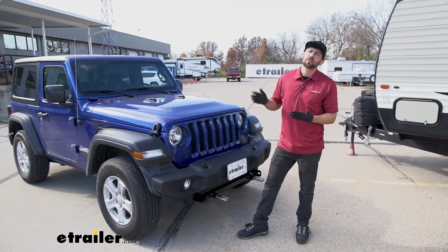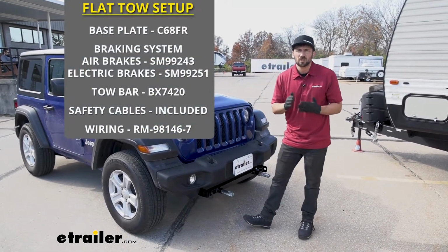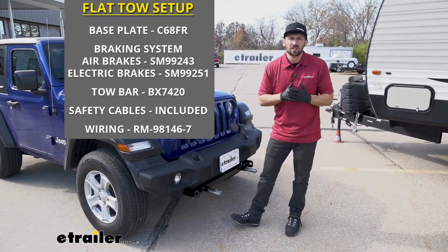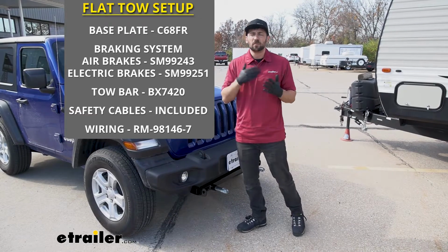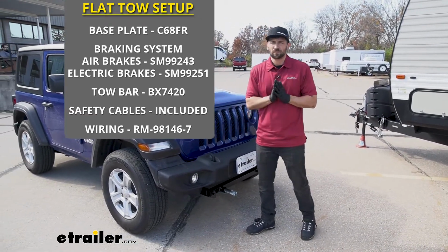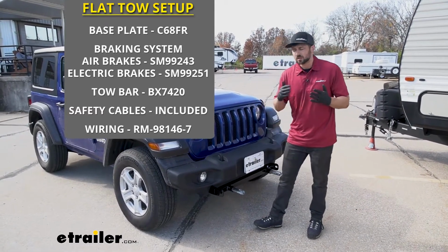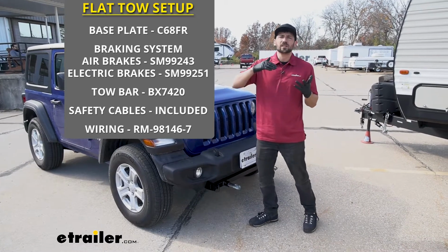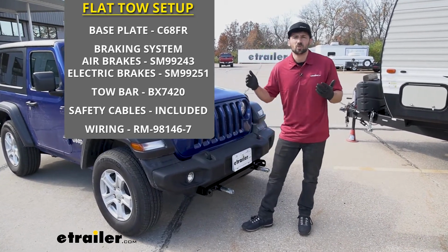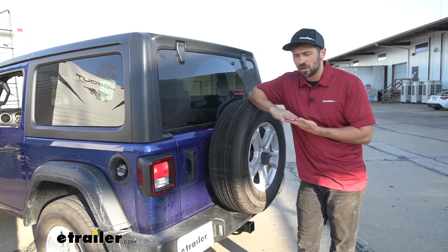There are actually a few other things you may need to flat tow the vehicle. A few of these things are, number one, a supplemental braking system. This is required in most states. It's not an actual requirement to flat tow, but many states do have a stipulation based on the weight of the towed vehicle. Some other things you'll need is a tow bar, which we already talked about, some safety cables, as well as a lighting system to power the lights on the vehicle to let others know behind you what your signals are.